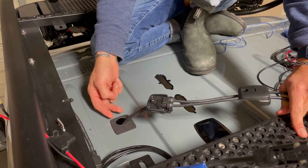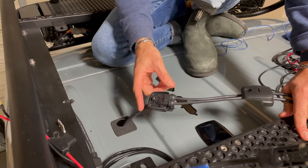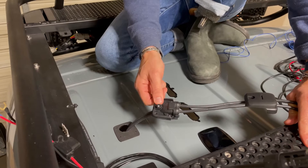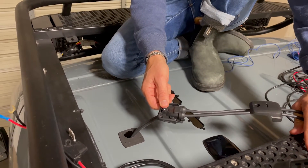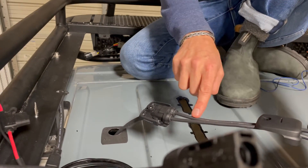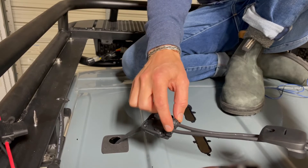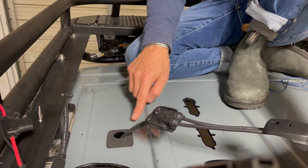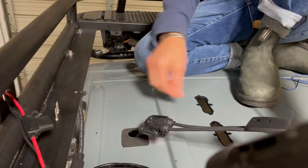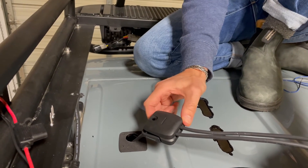Next, run your solar wires up through and put the foam pad down for your DS-HD6. The solar wires go up through the van and through the base of the pass-through. Then install the rubber washers along the solar wire into the base — that forms the watertight seal. Then mount the base down to the van using the included stainless screws.